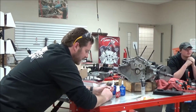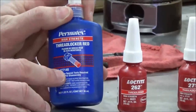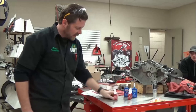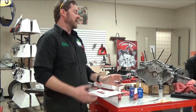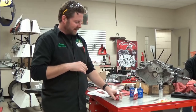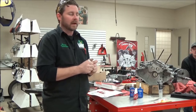This red says high-medium strength according to the website, but look at the bottle — it says high strength. The website says high-medium. And this Permatex says 'may require heat to remove.' Permatex even has different strengths of red. They are not all the same. Harley-Davidson told us to use this specific product. If we use what they say to use, with the right amount of drops and the right application, our chances of success to duplicate what they did when they designed this to begin with are really high.